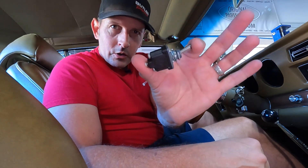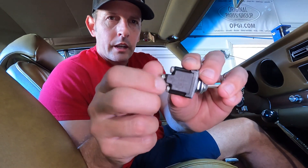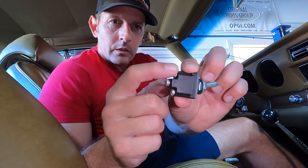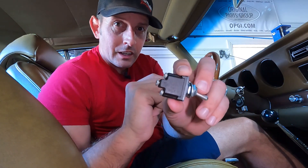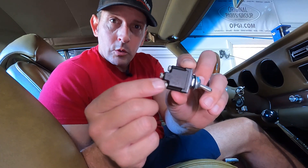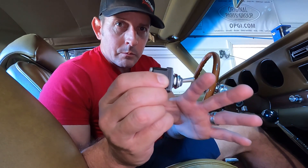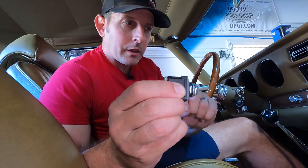Now we get to test the pump for real. Last episode I talked about a three-way switch I put in my console — it's a single-pole double-throw toggle switch with three contacts on the back. The middle contact is the common, wired to the pump relay. One side connects to keyed 12-volt, so when the switch is down I can run the pump without starting the engine — which is what we're doing today for testing. The other side connects to your throttle body. Switch up is normal operation for me. I also have a fuel pressure gauge installed, so we'll watch that too.